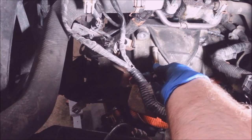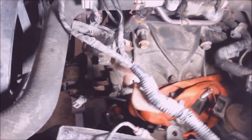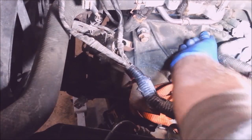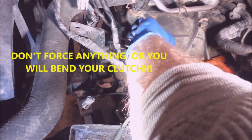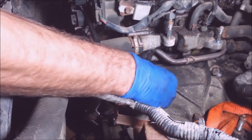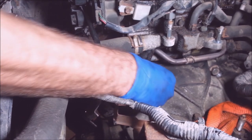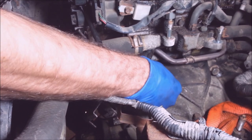I'm going to start a couple of bolts because I think I can. I heard that — I think it popped in. If you can turn these in by hand, the alignment pins are almost all the way lined up. It's really, really close. If it doesn't feel right, you don't want to be forcing the clutch and pressure plate and pilot bearing — this stuff has got to fall in on its own. You can't be forcing it.